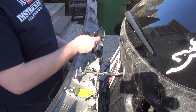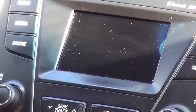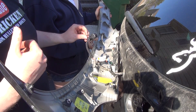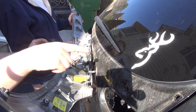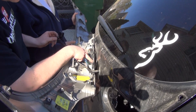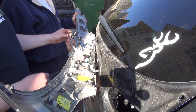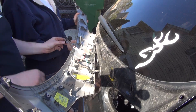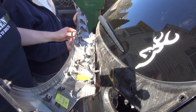Throw it into park. Throw it one more time in reverse just in case. I've noticed why this camera is getting salt-corroded. Water is leaking down, making its way into this panel. Look how filthy this panel is — full of salt and pollen, and it's corroding this. So I think what is a good idea is to actually apply RTV, at least in this area over here, before we attach this panel back on to prevent any water or moisture from coming down and attacking this new camera.